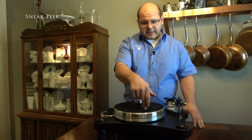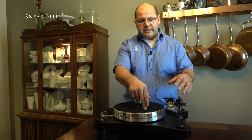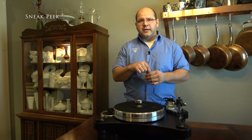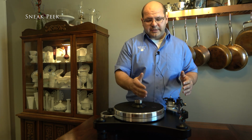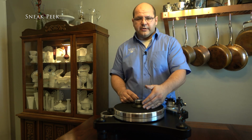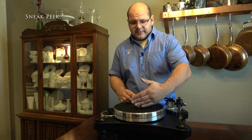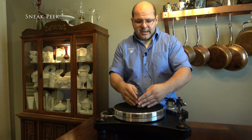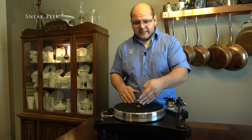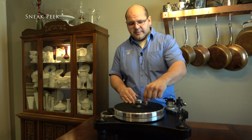Overhang is essentially the point on the setup jig that you're trying to get your stylus to fall exactly on that mark. And that's kind of your overhang, so how far your pivot to spindle distance helps dictate your overhang. And then you want to set your angle with your protractor. Your angle for that is actually twisting the cartridge like this so that it is straight and overhang's correct. And then your tilt is going to be your azimuth, so it's entering the groove correctly. And then your VTA is that stylus adjustment doing that.